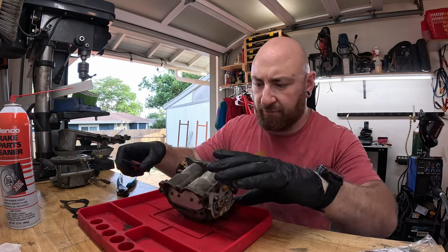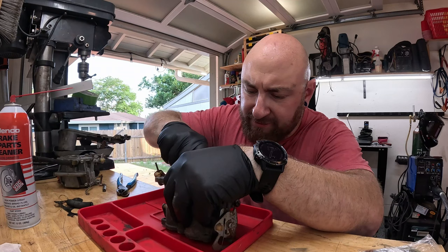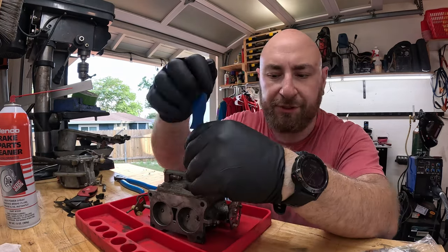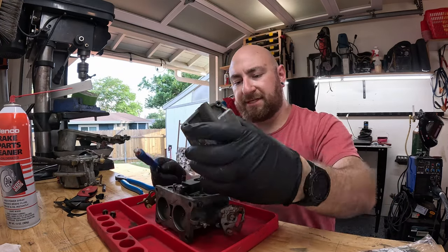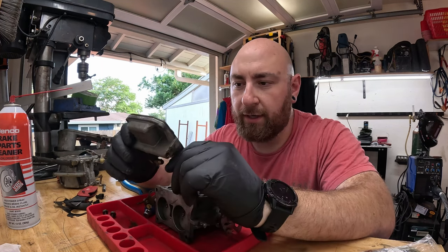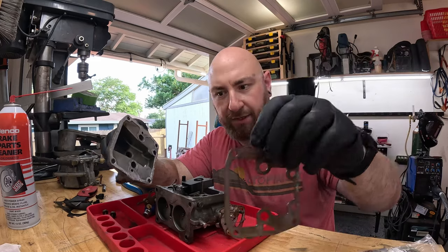So we're gonna start by peeling away this gasket, which we have new ones of, so we can peel that off, discard it, wasn't too stuck. And we're going to remove what's left of this hose, which frankly isn't very much. Let's start with the fun part, which is the bottom. Now this entire boat seems to be assembled out of flathead screws, which I gotta say, not my favorite thing. And then we give it a tappy tap tap. And there we go. And you can see this is what it looks like when you have fuel that has oil that has dried out. You end up with a bunch of caked on goop in the bottom. This gasket doesn't actually look all that bad, but we're gonna replace it because we got new ones.